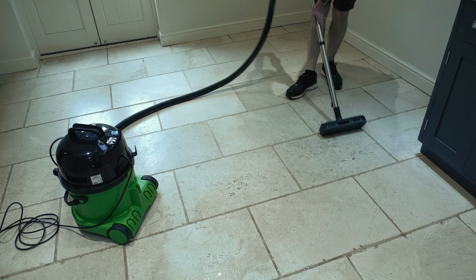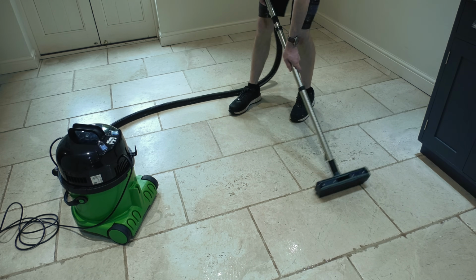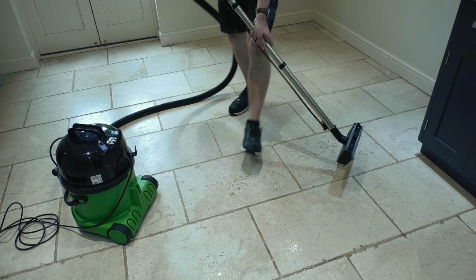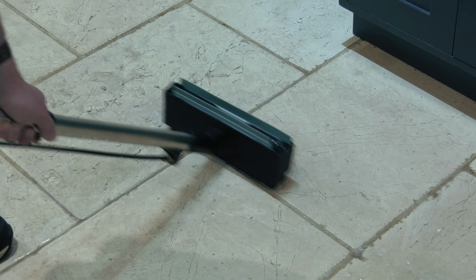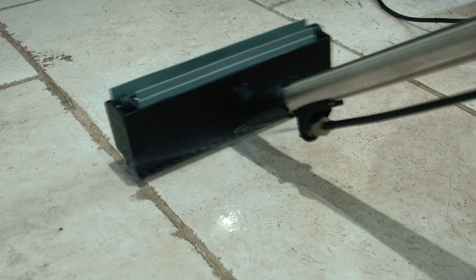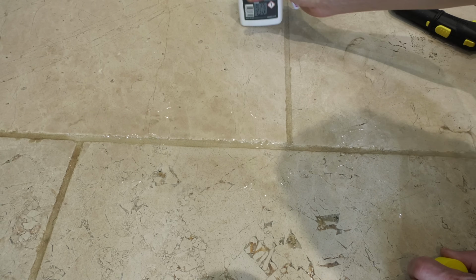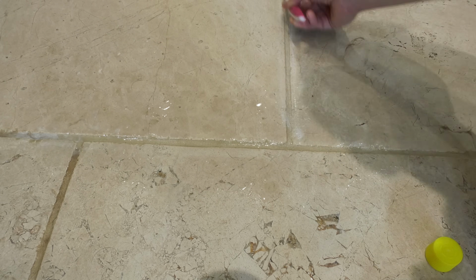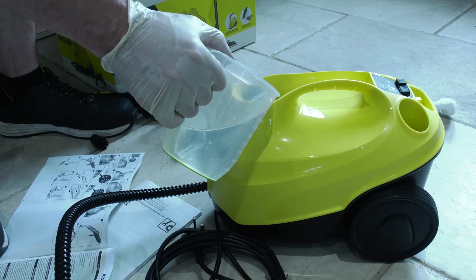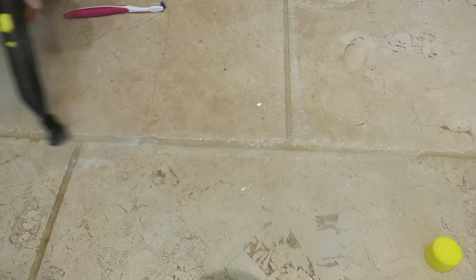You'll obviously have noticed that the scrubbing is fairly manual with this vacuum system and could be seen as a disadvantage. However, I don't see it that way with my floor. I'm convinced the dirt in the grout was far too ingrained for any system like the Vax with its integrated powered brushes to dislodge. The most effective way to get it clean was to use the scrubbing brush on the vacuum, and also a more targeted combination of grout cleaner and, when I was a bit braver, bleach with an old toothbrush initially, and then more effectively with a Karcher steam cleaner.